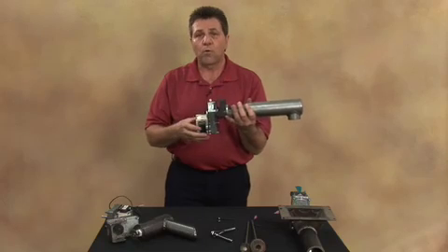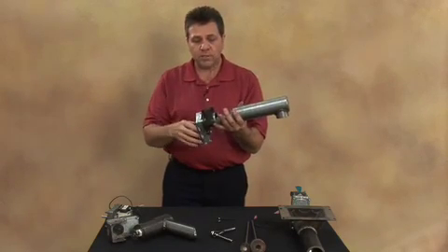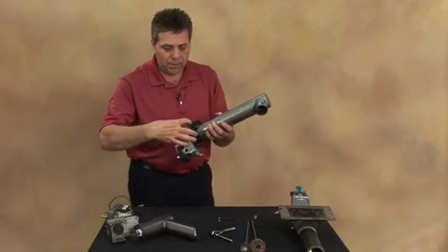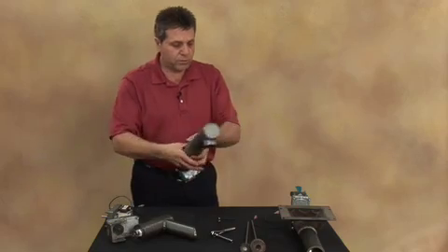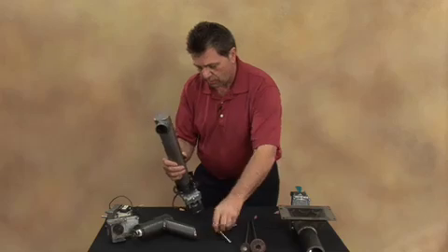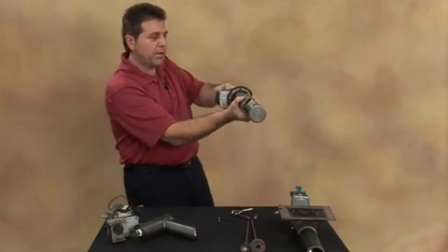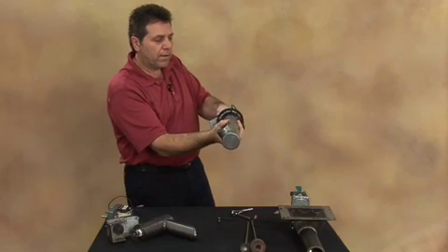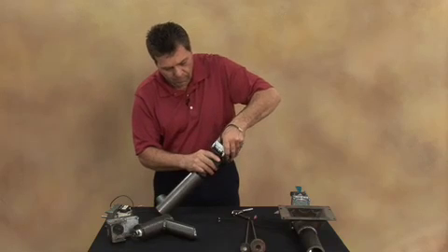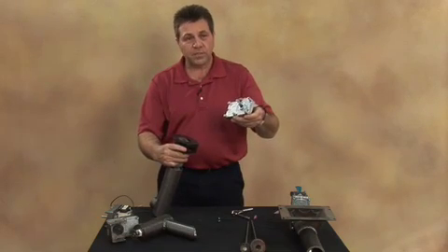There are two ways to take the auger motor off should you need to take it out to clear out the auger system and possibly hone it out. You can take it off by loosening the screws located on the back, and once those screws are loosened you're able to pivot the auger, line it up with the screws, and take the auger system right off.